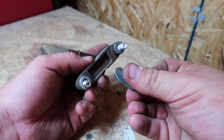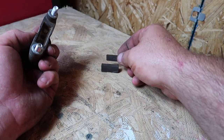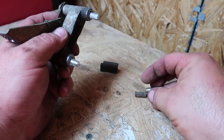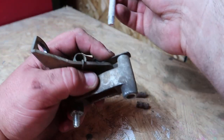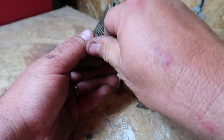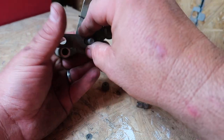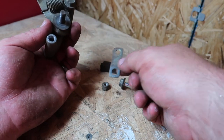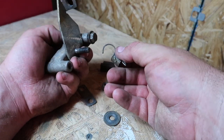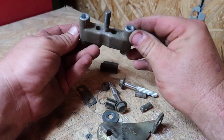Let's go ahead and remove everything. This is your brake pad — it looks worn but it has plenty of life left; if yours looks like that, there's no need to replace it. This little metal piece goes between the pad and the two pins. Remove the pins and place them aside. I went ahead and removed the rear mounting bolt from the brake assembly, then removed the mounting nut for the mechanical arm assembly. Once that was off, I removed the clip that goes between the mounting nut assembly and the back bolt, then removed the washer, the spring — which hooks onto the front bolt — then that bolt and the mechanical arm. There's everything torn apart from this brake kit.